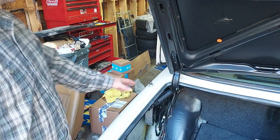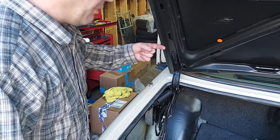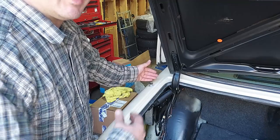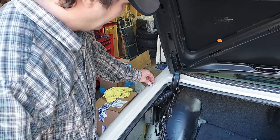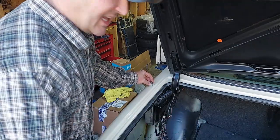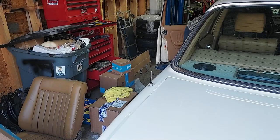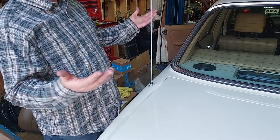These old cars are amazing. I took the antenna out, hooked it up to power, let it re-park itself on the workbench, lubricated everything, and put it back in the car. The issue was the antenna had somehow become un-parked and lost — it was no longer synchronized with the electrical system. As soon as I plugged it back in and gave it power, I heard it park itself.